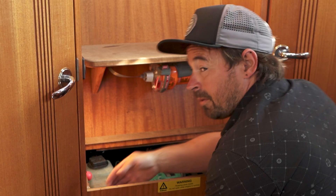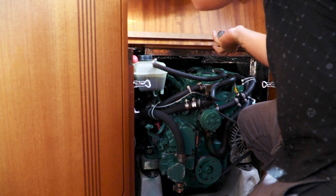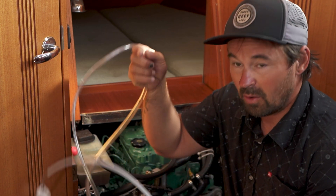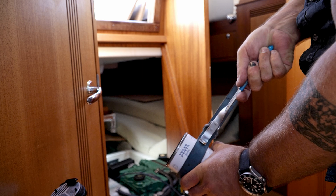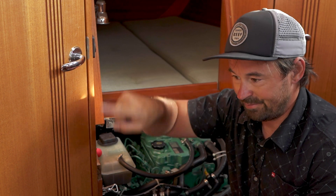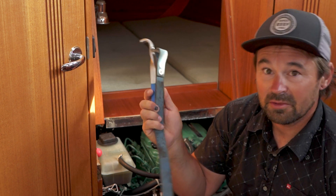Let's find the engine on this boat. It lies under here and we've got pretty good access — a couple of clips, so we can undo those and take the last part out to get a bit more light. Quick rundown on the tools: we've got the Seago vacuum pump, which comes with a whole host of hoses and a funnel. I've got a strap wrench for taking the oil filter off. The metal ones with threaded steel bar and banding don't last well in a marine environment, but this one's been with us for ages and looks as good as the day we bought it.